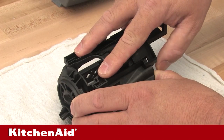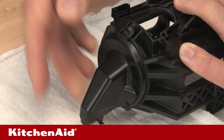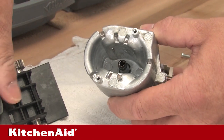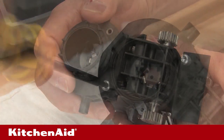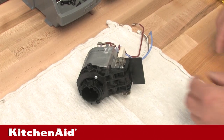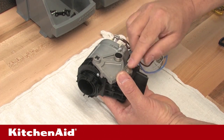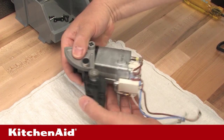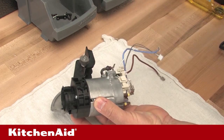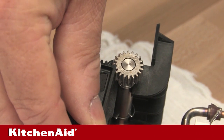Reassembly. Snap the slider and steam cover back in place on the brewing unit housing. Make sure the O-ring and spacer are in place in the thermoblock and then reattach the capsule cage to the thermoblock using the two screws. Place the thermoblock assembly on its side with the capsule cage to your left. Place the right gear lever back into place on the capsule cage, making sure that it seats and is in full contact with the gear wheel. Rotate the right gear lever clockwise while holding it onto the capsule cage and fully forward using the middle and forefingers of your left hand. Turn the unit over and place the left gear onto the capsule cage. Rotate the left gear clockwise until it just comes into contact with the gear wheel.